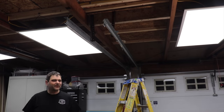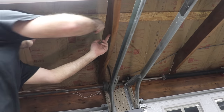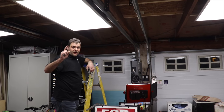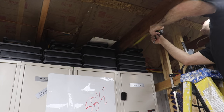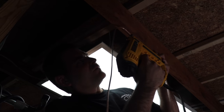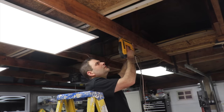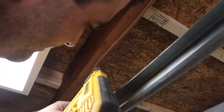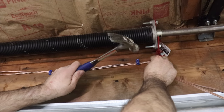And then it was time to figure out where I wanted these speakers mounted and where I needed to run the wires. I'm using a staple gun to secure the wires into place. Since these are low-voltage wires, this should be just fine. I'm also using insulated staples for the bulk of this, after the wires double up as it wraps around the perimeter of the shop.